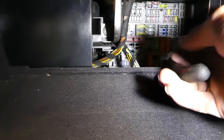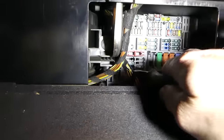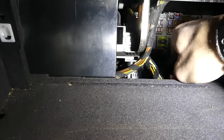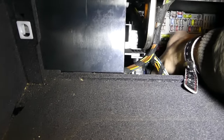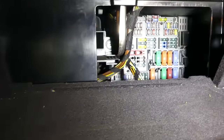If you want to pull a fuse, let's say fuse five on the bottom, which is related to tail lights, headlights, things like that — go ahead and pull it with the pliers. Easy, just like that. You can install it back with the pliers or even with your hands, but it's hard to pull them out without pliers.